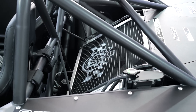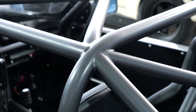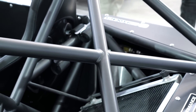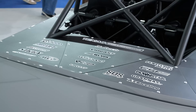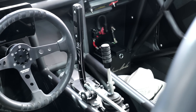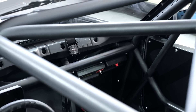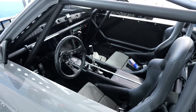The last thing to discuss is the radiator relocation. It looks like it could have stayed up front — is this aesthetics, personal preference, weight and balance, or all of the above? Definitely weight balance. This car has no weight in the rear — it has such a long rear end, a forward driving position, and a forward engine position that even the stock car has two 50-pound weights permanently bolted into the trunk on isolators. Take those out and you can literally just lift the back of the car up. So trying to get roughly a 48/52 weight balance, moving the radiator and most of the fluid to the back, putting the fuel cell as far back as possible, and getting a substantial diff helps move weight rearward. And it just looks cool.